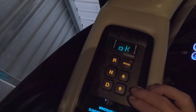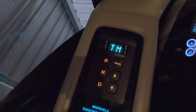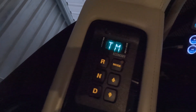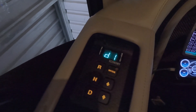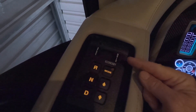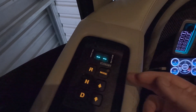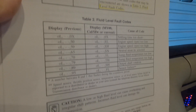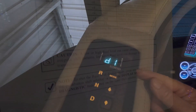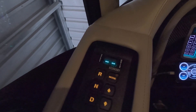The next diagnostic mode on the fourth press is the transmission health monitor — TM for transmission health. It reads OK, so we're good to go. If you see L0 or any other codes, write them down because they're not normal. The last mode, entered by pressing again, is the diagnostic memory mode. In this case, diagnostic code memory one is blank, and that's good. If you saw something after the D1 position, you'd want to copy the codes down — for example, P0722. You'd copy that down and give it to your mechanic, and they'll know what to do.